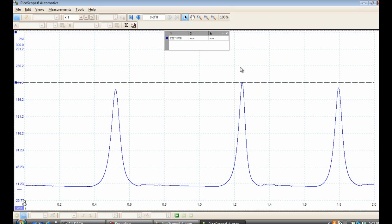This took like 15 minutes to capture these two scope shots. And immediately, I was helping a guy diagnose this one — as soon as we saw this, he went straight over to the vehicle and tried to crank it holding the gas pedal at 100% to turn the injectors off. As soon as he did that and stopped washing the cylinders down, it cranked up. Total time in the vehicle was 30 minutes. This is one of the examples you can use a pressure transducer for to help diagnose vehicles.